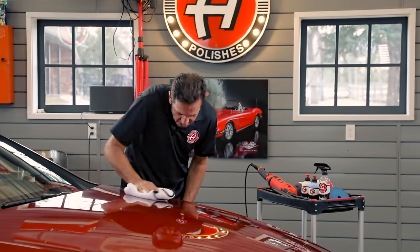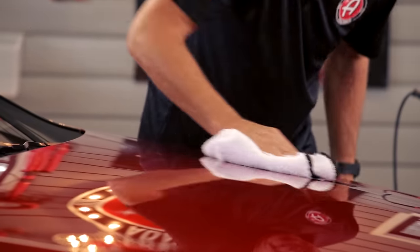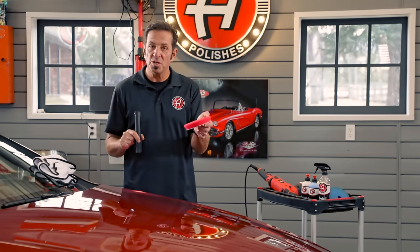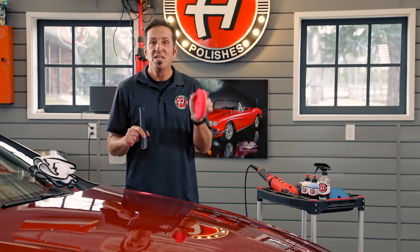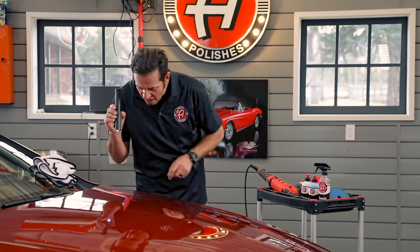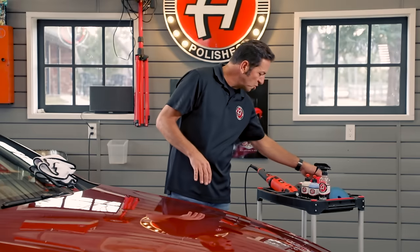When I'm done for the day, I want to use our microfiber revitalizer to clean this pad super well, rinse it out, wring it out, and leave it to dry. While using it, I continually use the pad brush to fluff up the compound so it continues to cut. I can see decent compound in there, so I'll throw a little detail spray on to re-wet the solids already in the pad. On this harder paint, instead of no pressure I'm going to put two to three pounds of pressure over the head. I'll take it from setting four all the way to setting six — full speed — moving across the panel very slowly to correct as completely as possible.